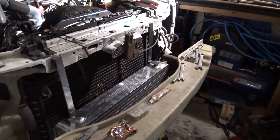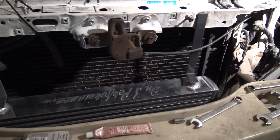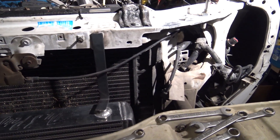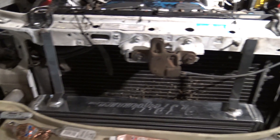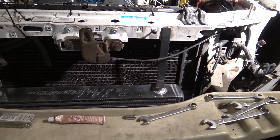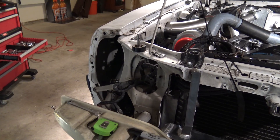Just gotta make sure the intercooler is nice and level — it's pretty damn close where it's at now. I think the intercooler would ideally be lying in the middle of the radiator, but it doesn't wiggle around with this piping here, all the way across. There's really no room — it might go over this way a little bit, maybe about a half inch — but you'll get a little bit more clearance over there.